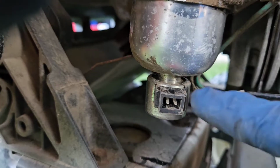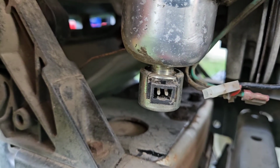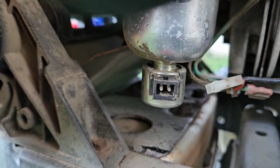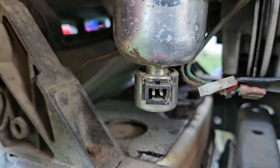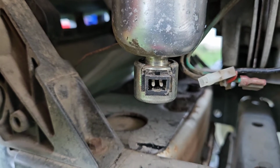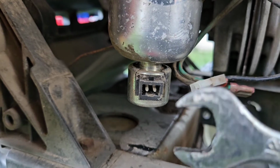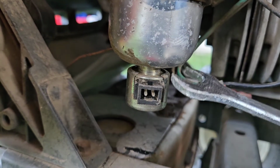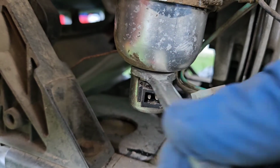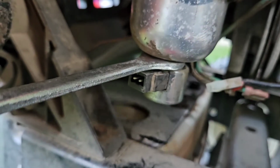So of course inside here where the flat parts are, it's like a 12 or 13 millimeter. I think it's 13 millimeter. However, I didn't have one that fit in there, but I had a real crappy wrench from a motorcycle toolkit, 12 millimeter, and I ground it down really thin to be able to fit in here, and I ground down the inside a little bit, and we got it moving. So I'm going to pop that off real quick.